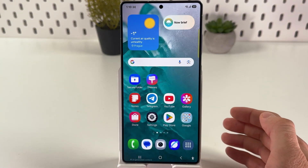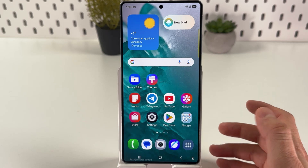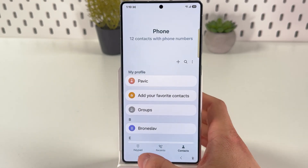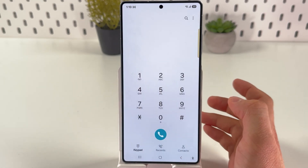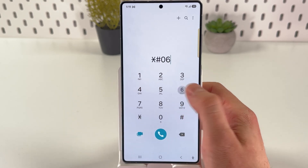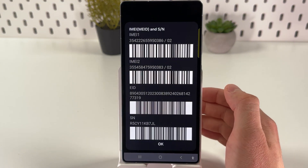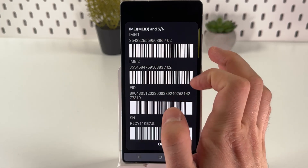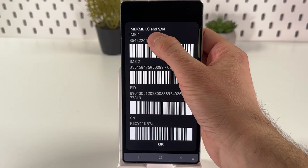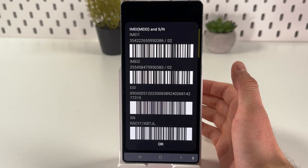One of the most important steps is the IMEI check. Open up your phone dialer, press on your keypad, and dial the following code: star, hash, zero, six, hash (*#06#). Here you'll see all your phone information — IMEI 1, IMEI 2, device ID, serial number, and so on. Take a screenshot or copy your IMEI number.